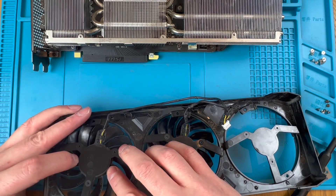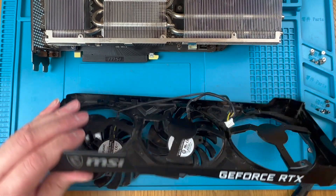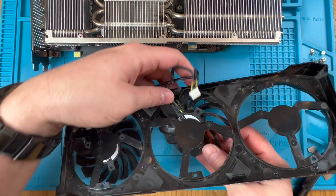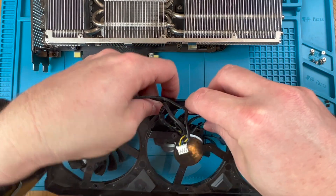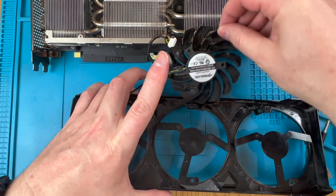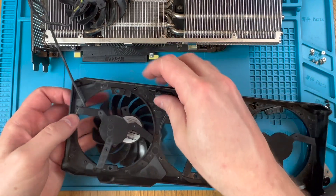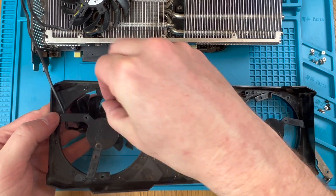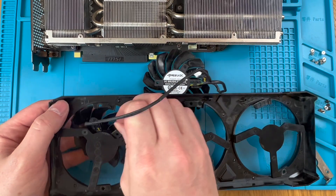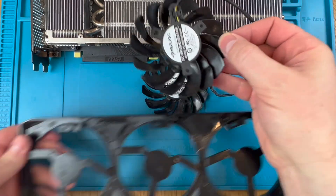You will notice that once you pop the remaining fans off, these two fan cables are actually connected and as a result you cannot easily remove the fans. Also, you may notice that the fans appear to be larger than the gap you have to fit them through. This part is the main trick to changing the fans as it is tempting just to manhandle the fans through the gaps, but actually rotate the fans so the cable is pointing up and then push the left side of the fan against the shroud. Now gently ease the other side in the direction of the fan blades through like you can see here. Doing this, it's actually really easy to get the fans out without damaging them.